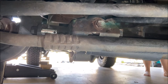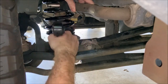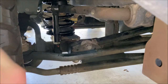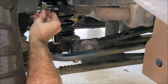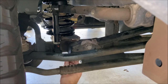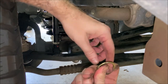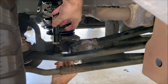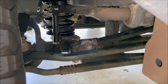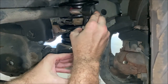All the control arms are torqued and the track bar is torqued to 125 foot pounds. The lower control arms are 125 foot pounds at all four bolts. The only thing left is to install the sway bar links. With the JKS quick disconnects it's simple — just snap them on. If you've got the rear sway bar links moved up to the front, you might need some help lifting the bumper to get the geometry right for both links, but they're actually pretty easy to install.